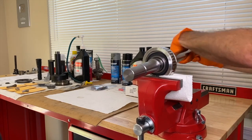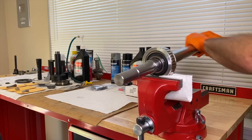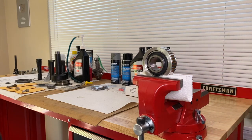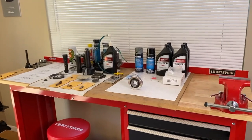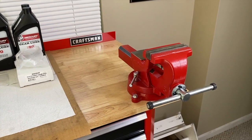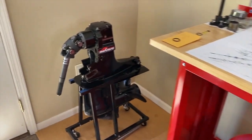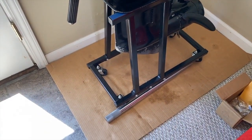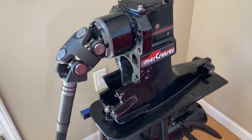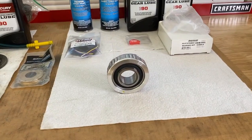I'll give you a quick movement view of it again — pretty neat. I'll realign it and carefully pull the alignment tool out. Using that alignment tool as if it were our yoke shaft installed to our U-joint assembly and upper unit hopefully gives you a better understanding of the purpose of a gimbal bearing and what it looks like when it's in use.